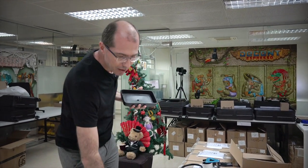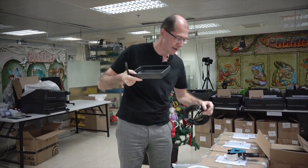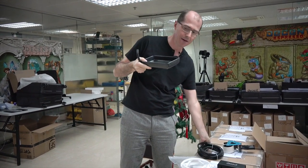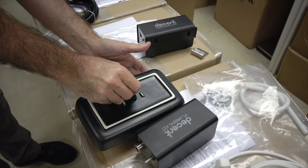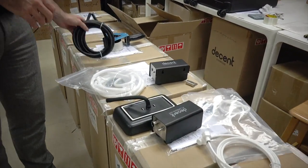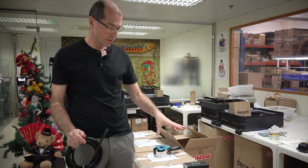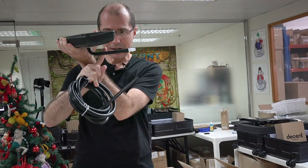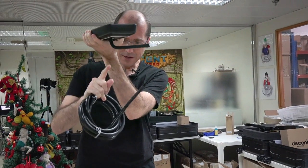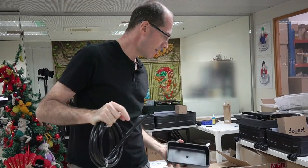On the draining drip tray you have an option to use this bendy tube. You'll want to do that if you've got your drip tray on a table, because if you plug this directly in it's going to bang in and kink. So what we've done is made these 90-degree molded cables — it's going to go over the top like so, and that's food-grade silicone. There's a barb on this end and you can connect this tube to go far away. However, the best solution is to have it drain straight down, as there is a slight worry that coffee sediment could get caught in the bendy section. If you can't do that, plug this in the back and get your dirty water to go out the back.